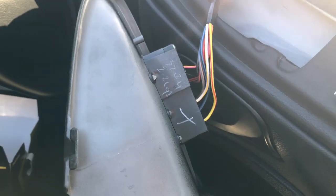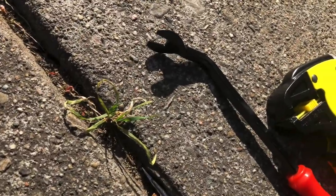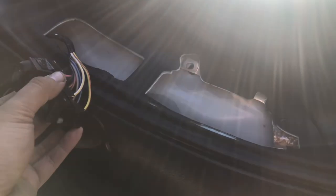At this point there should be two Phillips heads to take off, and near the speaker area there should be a Christmas tree type push pin connector — go ahead and take that off using your plastic prying tools. Once you've got these two bolts off, the push pin Christmas tree connector removed, and the tweeter off, the door panel should be ready to come out.